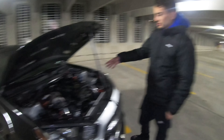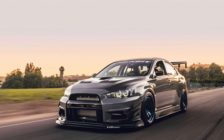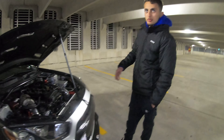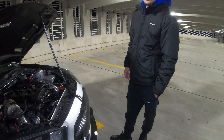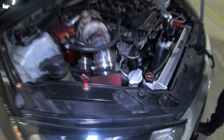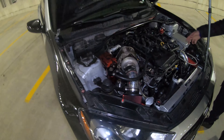So let's explain the car. We got a Dyno Two Racing spec motor — it's a 4B11 from the Evo 10, which a lot of people don't know comes stock in these cars. We sleeved the motor, got H-beam rods, forged pistons, did the O-ring head, big 625-plus head studs from the Evo 10. We got the GSC Stage 1 cams, titanium springs, rockers, and retainers.